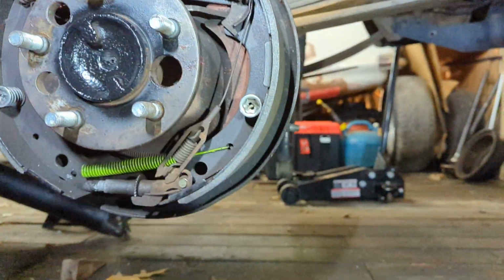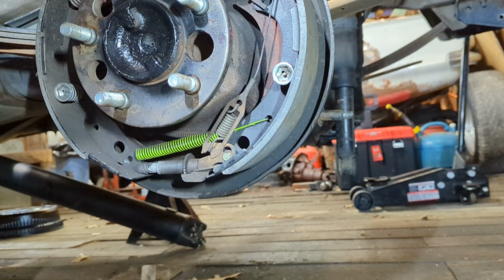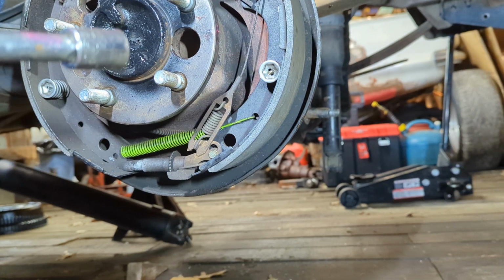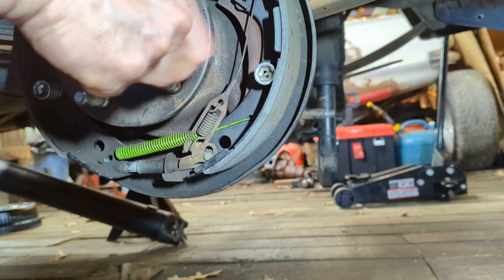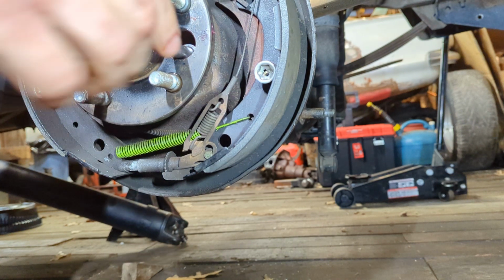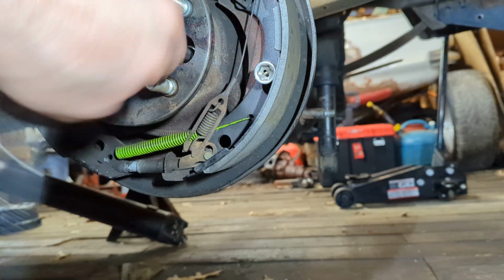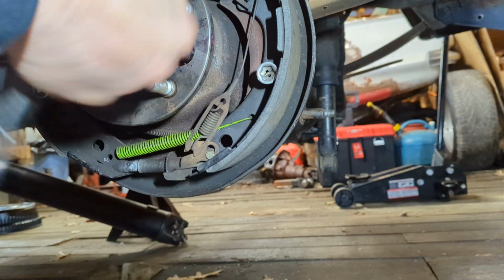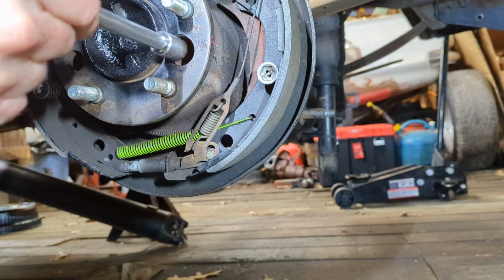Okay, y'all. I went and put almost all the retaining nuts on here. I went and got a couple tools. Socket and extension and ratchet, and there's a hole, the large hole right there, what I'm using. When you do this, you'll see there's probably 2 other holes. You might even see them in the video. You can't use those. I tried. Socket size is 9/16.